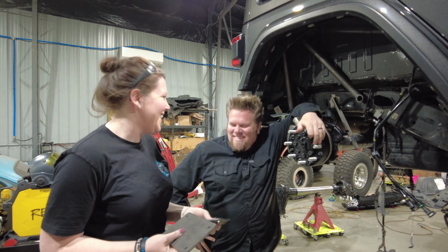Anyway, okay, so the point of this plate is that this plate does two jobs. This plate not only acts as the upper shock mount, but when Abe builds his cage, this will be the roll cage plate on the top side. So we'll cut another one of these plates that'll go inside the Jeep. So then when the roll cage sits here, the load from that cage gets transferred down through the shock mount, and then down these tubes to the frame.